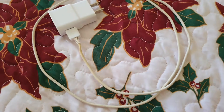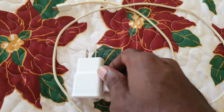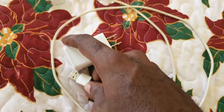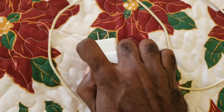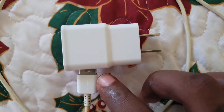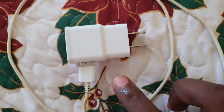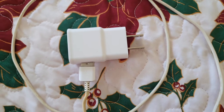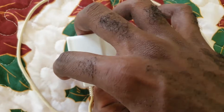Sometimes it's obvious as to what the problem is, other times it might not be. As you can see you have the charger, and the issue in many cases is that maybe you were in a rush and when you connected the charger cable to the brick you didn't shove it all the way in — there's a gap. The device is delivering power, however it's not delivering full power, and your smart device is able to detect that there's an issue and is diagnosing itself. All you've got to do is check the connection.